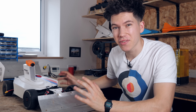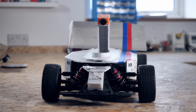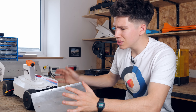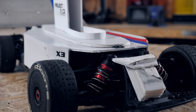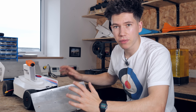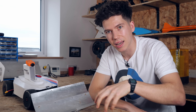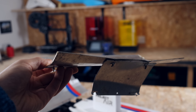So what have we actually learned from these tests? I recognise my experiments weren't that scientific with different days and different conditions, but I think there are some indicators here that downforce works on RC cars. Just look at some of the onboard video from the last test runs with the larger front wing — you can see that the wing is flexing and pushing the suspension down. But I think at least for this RC car you need to be going extremely fast and have these huge wing surfaces to actually do anything. The one obvious thing I neglected was the mass of the car — inertia is a powerful force, and with this six kilogram RC car changing direction requires a lot of grip and a lot of force pushing the car into the ground. So at this scale the car is too heavy, but on more lightweight cars downforce could be a really helpful thing.